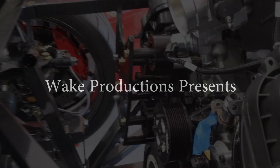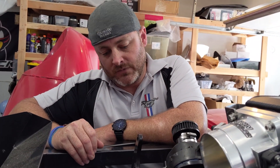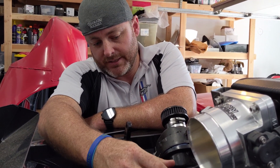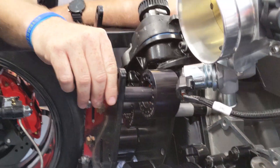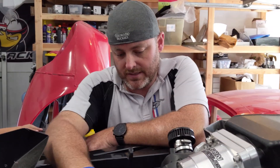So you got a 10-rib setup finally? Kind of. We do. So 10-rib setup. Still need a belt. Still need a little bit of shimming and whatnot, but there are some gigantic pulleys. We'll get them nice and tightened down once the blower's on here, but we did have a little bit of slippage with an eight-rib, so maybe going to 10 will help.